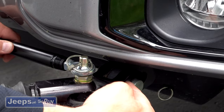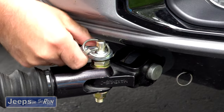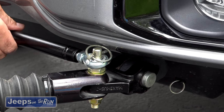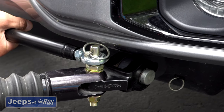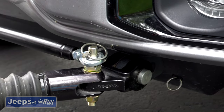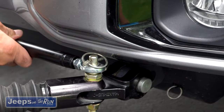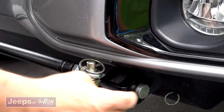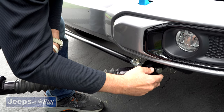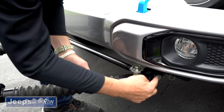To adjust the bar, if your jam nuts are tight, loosen them on both sides and bring them all the way out to the heim joint. To adjust, you spin the bar — one way makes it bigger, the other way shrinks it. When looking at the knuckles, you want to get them to the point where they are straight. You don't want the bar sucking them in and you don't want the bar pushing them out. If you're gonna be biased either way, you can err toward sucking them in slightly, because the pressure is always going to try and push them out. Keep these things as straight as possible.